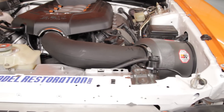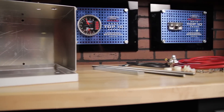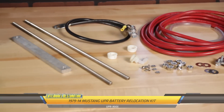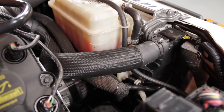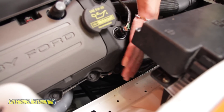Because of the driver's side air inlet location of the Coyote motor, you will also have to install a battery relocation kit. You can't really relocate the air inlet to the passenger side because of the upper radiator hose, and you can't run a 79-85 battery location on the passenger side because of interference with the valve cover.